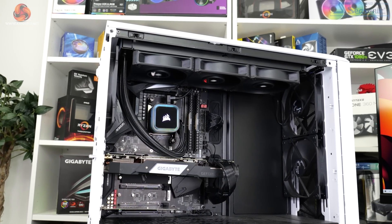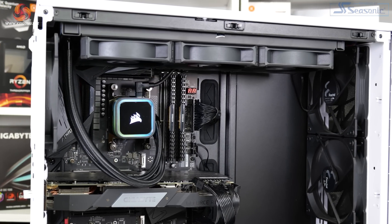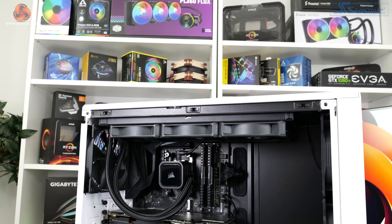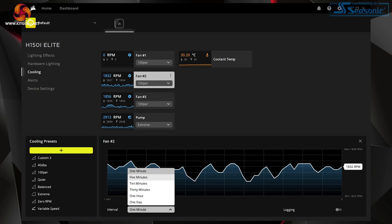The iQ H150i RGB Elite is a positive new addition to Corsair's vast array of liquid coolers. The real focus point here is clearly the inclusion of the company's new AF Elite Series fans, and the sizeable LED housing design on the pump block cover is the other differentiating feature. Performance is as good as we would expect from a 360mm all-in-one. While the H150i RGB Elite wasn't quite as proficient as the top runners in our charts — largely due to lower RPM fans — a good enough showing was put in against Fractal and Deepcool triple fan AIOs. However, the 100% fan speed noise output is higher than we would expect from a cooler with 1850 RPM fans, and the 40 dBA noise-normalised performance data, which is behind the leading pack, backs up that point.